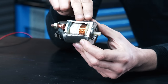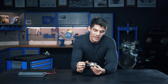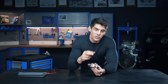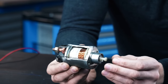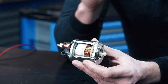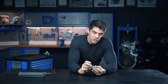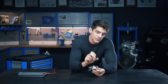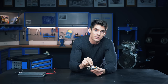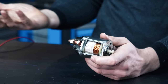It's quite common for there to be two coils inside a solenoid: a strong pull-in coil that pulls in the plunger, and a second weaker hold-in coil which holds it in position — because it takes much more energy to pull the plunger in from outside than to hold it in place. When the starter contacts are made, a switch also de-energises the pull-in coil, saving a bit of power from the battery while the starter is cranking.